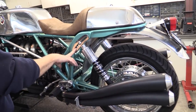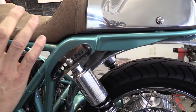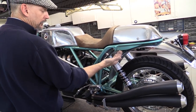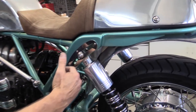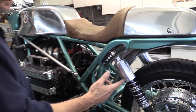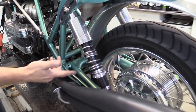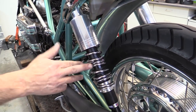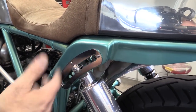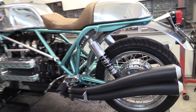This is from the Thruxton — the British bike. It's a preload adjuster: stand it up and it gets stiffer, lay it down and it gets softer — that's how you adjust the preload on those bikes. In this case, these are triple-rate springs with full rebound, compression, and preload dampening, custom made for this motorcycle by Works Performance. This Thruxton piece isn't a necessary component — it's aesthetic — but it does still function. You can also adjust through the adjuster on the shock.